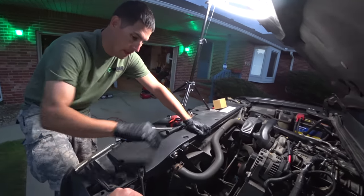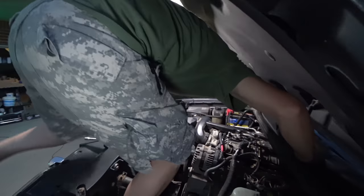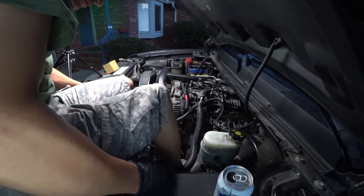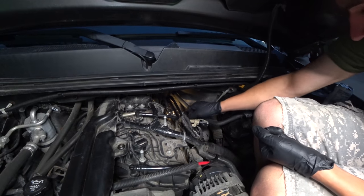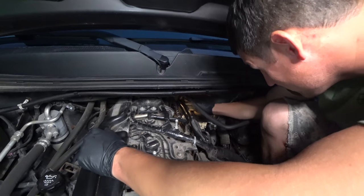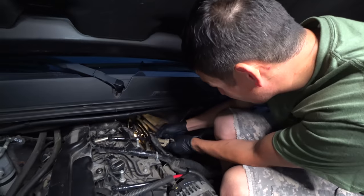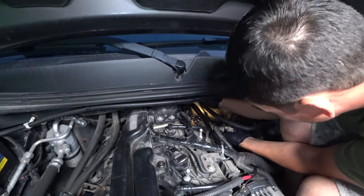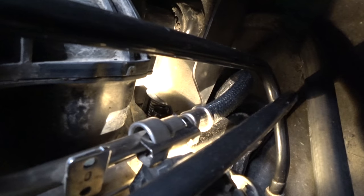Going in. If I'm not back in five minutes, just wait longer. There are going to be a couple of harnesses here — don't break them. And the drive steering column is not something you really need to put a lot of pressure on either. Everything here is going to be done by feel, even though you can see it. The beauty is you don't actually have to disconnect any of those hoses, if you've got skinny arms anyway. Got that clip off — that one actually came off pretty easily. The harness is off now, already. The oil pressure sender is back there now — it's been disconnected. Difficult to see, but everything here has got to be done by feel.